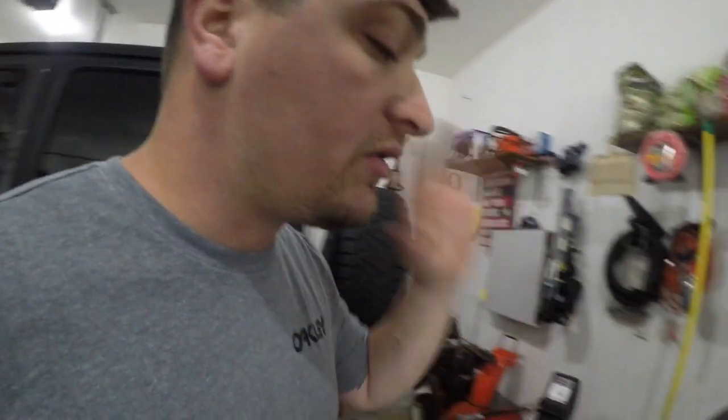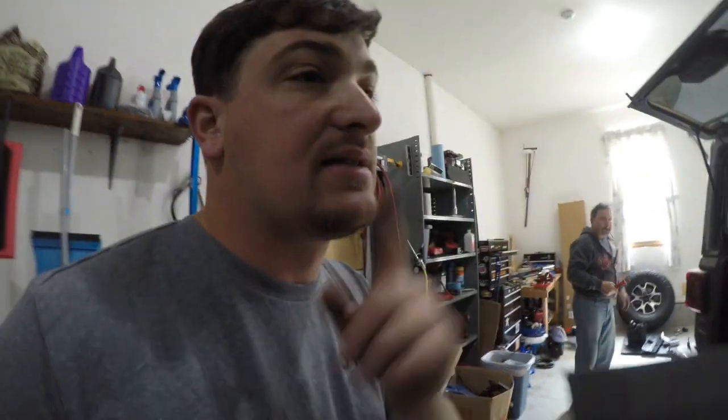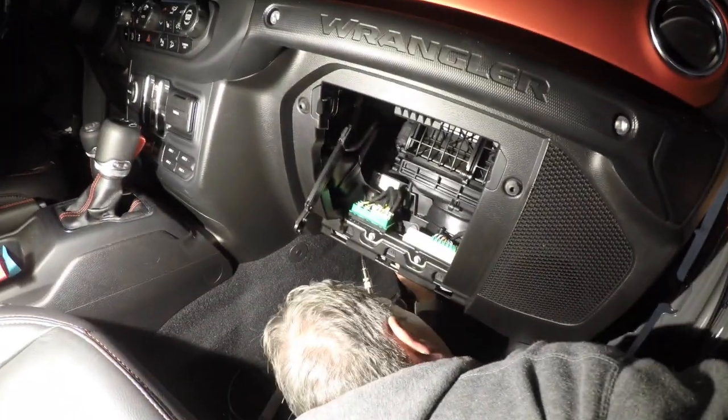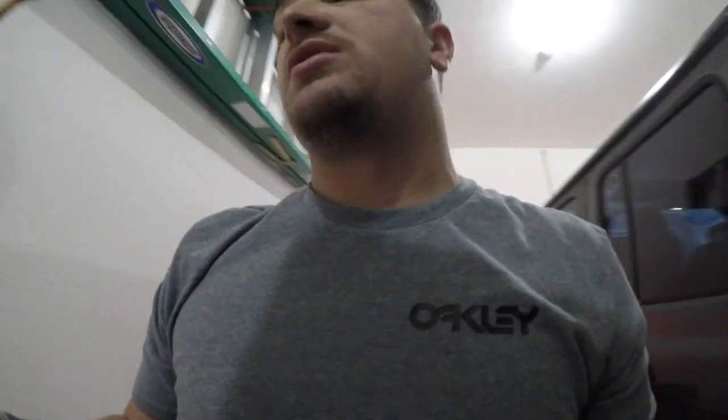Now we can go ahead and tune the CB radio — that's a little time consuming and there are a lot of good videos on how to do it, so I'm not going to explain it here. We're just about finished up; all we have to do is mount the antenna box up under the glove box. I'll show you clips of where I put mine on my Jeep — it's zip-tied up right by the passenger side heater vents. That's the entire install. When we tuned his antenna it worked out pretty much on point — we didn't have to mess with it at all, which was really nice. Like, share, comment, subscribe — do all that typical YouTube jazz. Have a good one!